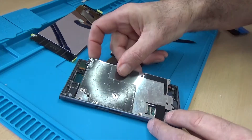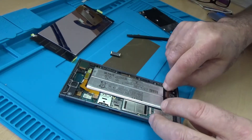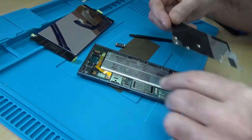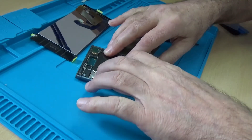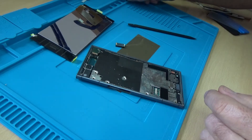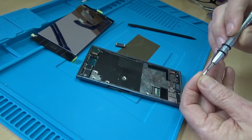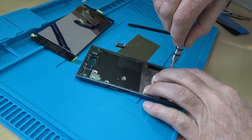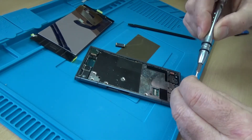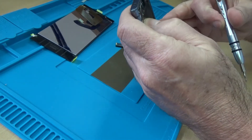This metal plate goes over everything, including this speaker, so the speaker needs to go in first. Make sure it's hooked underneath, which it is, and then connect the battery back up and screw the plate on. Then we can fit the screen on top. Unfortunately I've only got two screws because all the screws were lost, so I'm going to put one screw where the speaker is to hold the speaker onto the contacts, and the other screw in the opposite corner. It should be all right because when the screen's glued down it ain't going anywhere — just make sure that's fully down.